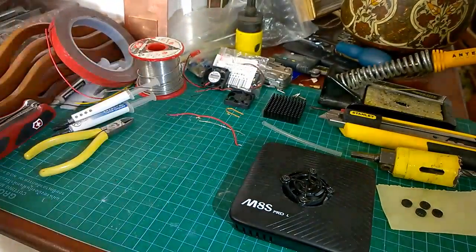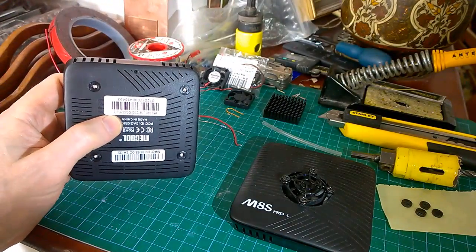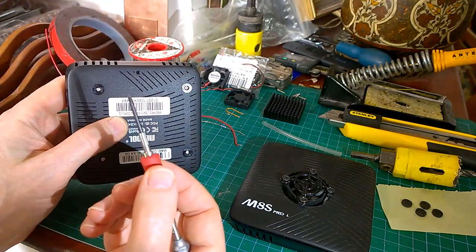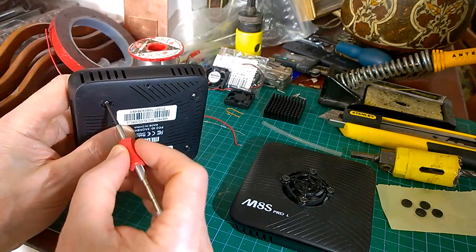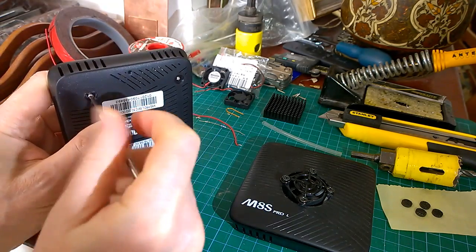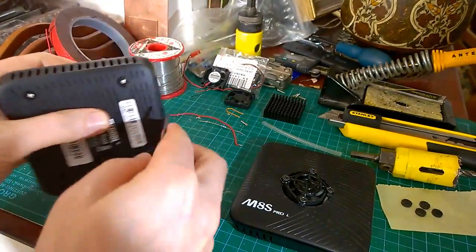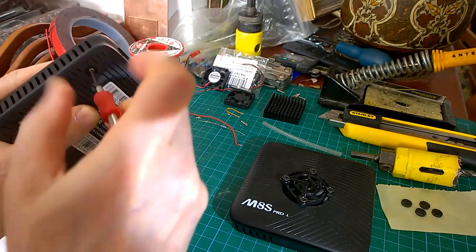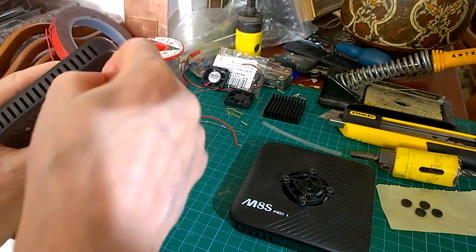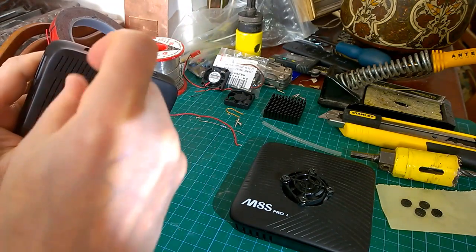Right, 4 little crosshead screws. You can use a little Phillips, although it does try and get away from you a bit, cam out as they call it. A JIS screwdriver fits them best, but they're difficult to get hold of, or at least you have to spend money getting them from Japan, really. But they're very nice when you get them, because they work really smoothly and they don't cam out, which is nice. But if you put a lot of pressure on a little Phillips, then they should work okay. You should be able to get it out.